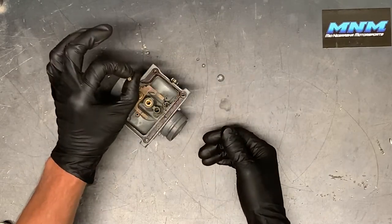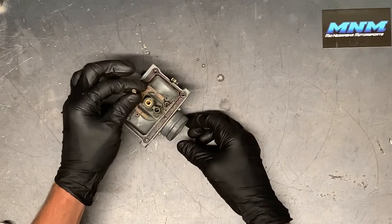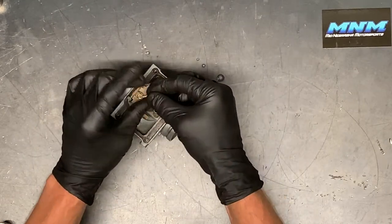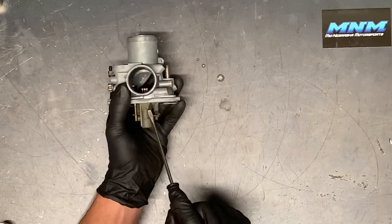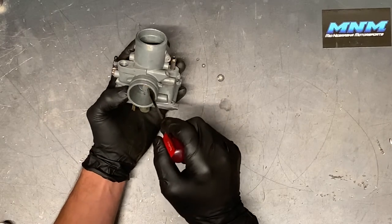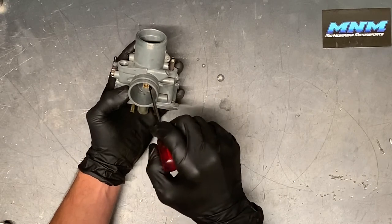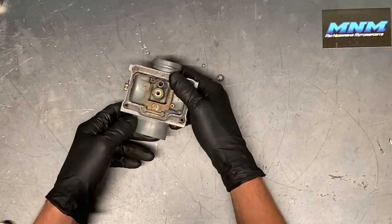Make sure you clean that pilot jet out really well. The pilot jet covers from start — no throttle — all the way up to about a quarter throttle. So if your four-wheeler has a hard time starting, more than likely it's your pilot jet. It's a very small orifice and gets gummed up very easily, or any sand or debris from your fuel tank can get sucked down and lodge in there. The pilot jet runs into this port here and comes up and out these two ports — one facing toward the cylinder and one straight up — to deliver the right amount of fuel to start.